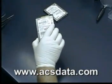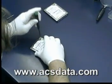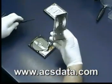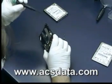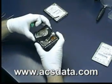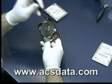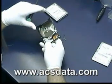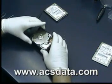These are fairly straightforward, so we're going to start by disassembling this drive and taking the heads out. This is a two-platter drive, so there are actually two hard disk platters in here and four heads. It's almost like a mini record player — the heads are like the needle on a record player, and this is like two records stacked on top of each other. You have a head for the top and bottom of the first platter, and a head for the top and bottom of the second platter. You have to make sure that the heads don't touch whenever you remove and then reinstall them.